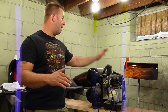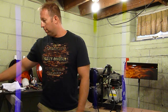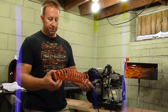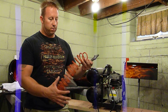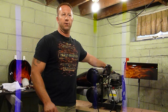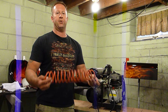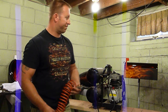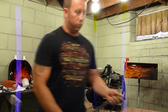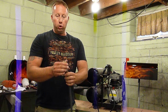You want a compressor that will supply more air than your paint gun will use. Real quick, I want to talk about hose. This quarter-inch little curly hose is a no-no if you're using anything bigger than an airbrush. This will not flow enough air no matter how big your compressor is or how much pressure you have your regulator set at. You could have it set at extremely high PSI and you're only going to flow so much air through this little hose. What I'd recommend is standard 3/8-inch hose — black, blue, orange, whatever. I like just the rubber Goodyear stuff. Standard air fittings are usually good enough.